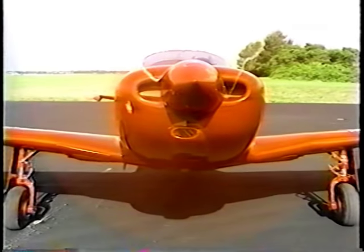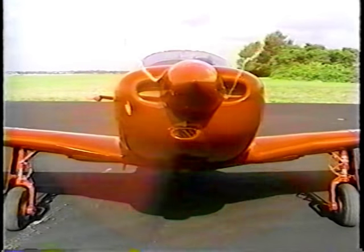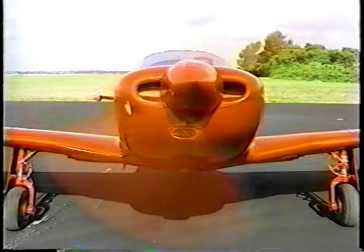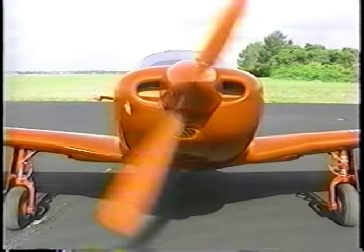Attention to technical details spells success for LoPresti Piper's new SwiftFury. One such innovation is the manually controlled ram boost valve, which allows induction air to bypass the filter, thereby increasing engine horsepower and speed. This innovative spirit began a year ago in a series of technical staff meetings at LoPresti Piper.